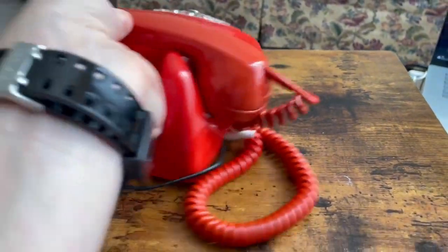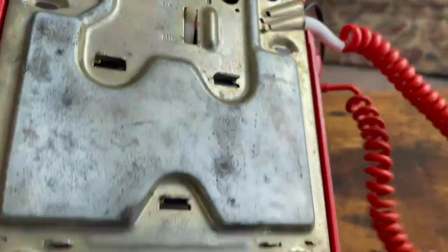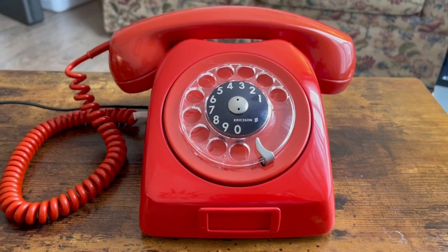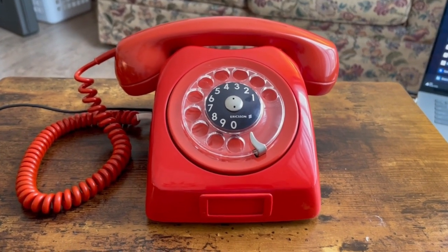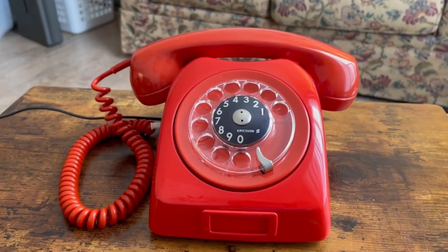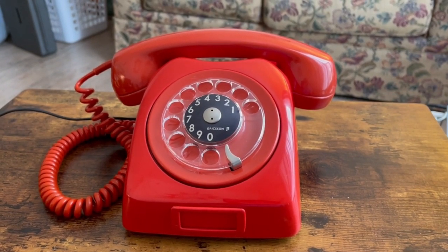I'm going to turn the phone around to show you. The PC board was obviously a mess as you saw before, but after some cleaning it looks a lot better. I also polished the bells in the ringer and did some heavy scrubbing on the other side of the base, which had a lot of dirt — I ran that under hot water to freshen it up. The phone is in good shape and working now; I'd say it's 99% working. The only issue is the spotty connection with the handset cord at the restraint — it's been bent around too much and is damaging the wires on the inside.